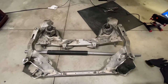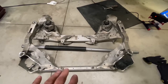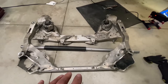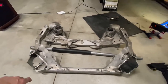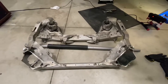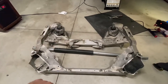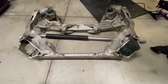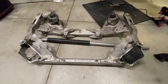Front subframe is off the car. Now that it's on the ground, I wanted to illustrate how you get it off. There are plenty of DIY videos online showing the process while it's on the car, but I wanted to show it differently. To get to the point where the subframe can come off: first, disconnect the control arms — one up front, one in the middle on each side. Take the sway bar off, then disconnect the 16mm nut on top of the motor mounts from the engine bay. Also remove the three screws holding the plastic cooling line, otherwise you'll break that coolant line.